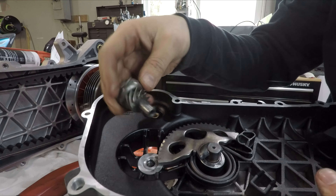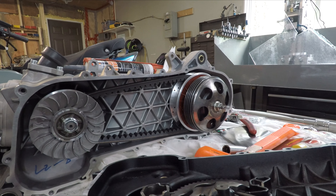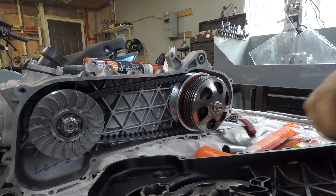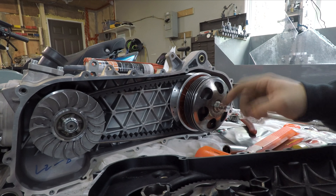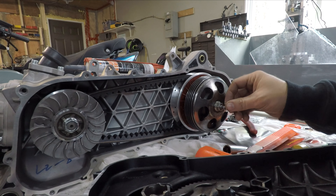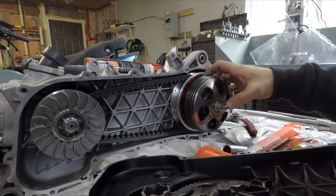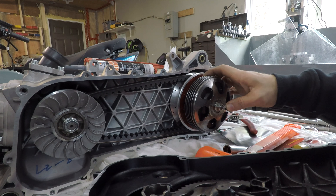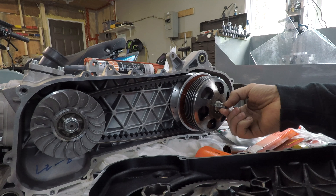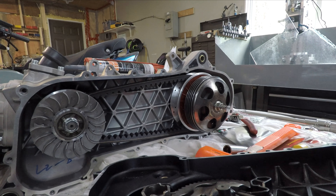Put the kicker stub in. Going back together - putting the cover on. I also noticed they don't include one of these little spring clips that normally come with it. Most people probably don't care, but since this is going to be a street-driven race motor I want to keep it as quiet as possible. That's just a tensioner for the bearing to keep it from rattling around - also not included in the kit. So next up we're going to install the cover. There are a couple of dowels in the bag that need to be installed, and then torqued to 11 newton meters, same as pretty much every other bolt on this.